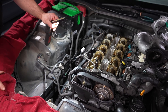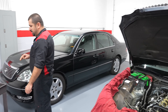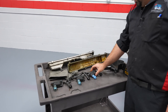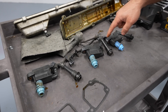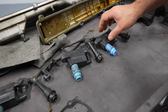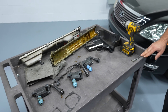Some oil will still make its way down to the cylinder — when you start it, it's going to be smoking all over the place. That's just the way it is with these. You've got to be patient. I see a lot of shops just booger it up and ship it. You've got to spend time with this. My concern with this car are the coils. This is a waste spark system — three coils and three spark plug wires for the other three spark plugs. Every coil actually fires two cylinders at the same time, kind of like the 5S engine in the Camry.